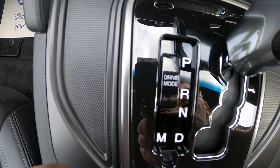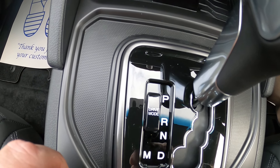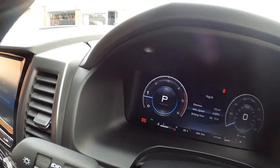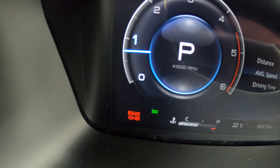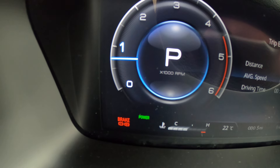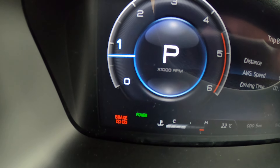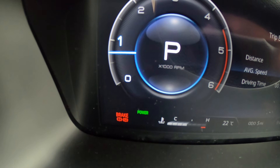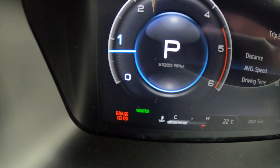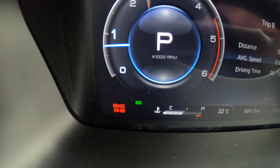Behind that we've got our gear stick. On the left-hand side of the gear stick it says drive mode — there are three different ways your gearbox can operate: eco mode, power mode, or winter. At the moment we're in eco. Power mode means the gears stay in a little longer before they change, giving you more time to accelerate between gear changes — useful if you're pulling something heavy. Winter mode short-changes a bit quicker to reduce your chances of wheel spin. Generally though, you'll just be driving in eco mode.